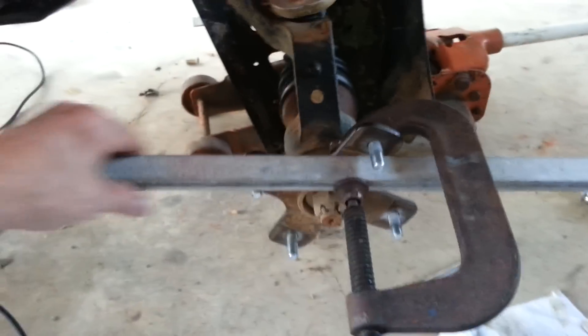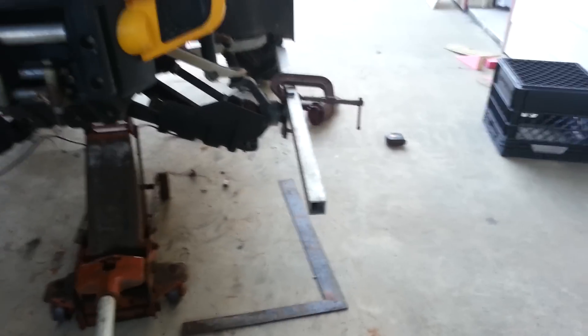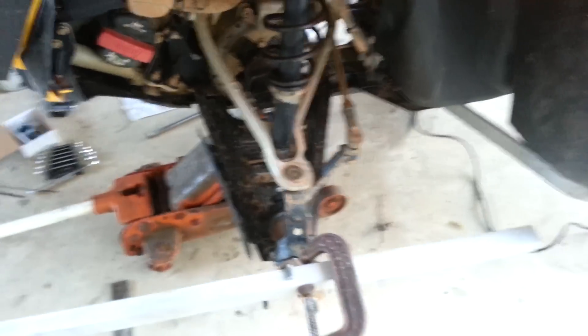Make sure you have a very good straight piece of metal — possibly it could be a piece of wood or anything that's perfectly straight. Once you have it straight, tighten up your nuts really good, and that will give you your straight front end alignment.